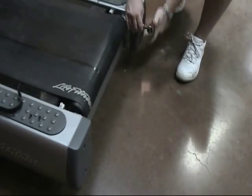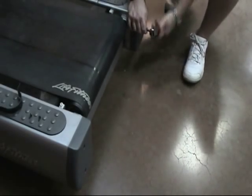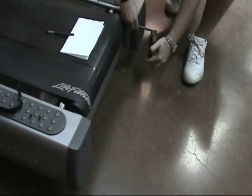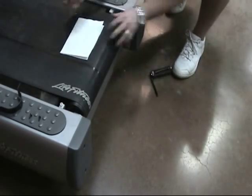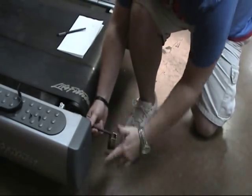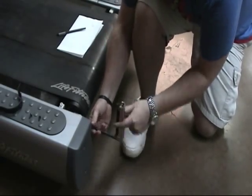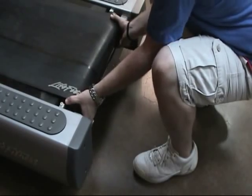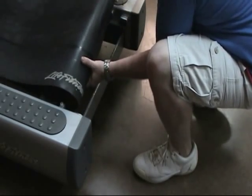At this point, you can completely remove the bolts from the rear roller while keeping count of the turns needed on each end of the roller. Do not count the 10 turns in the previous step, just count the turns needed in this step and be sure to write it down for future reference. Carefully remove the roller from the frame and set it aside.